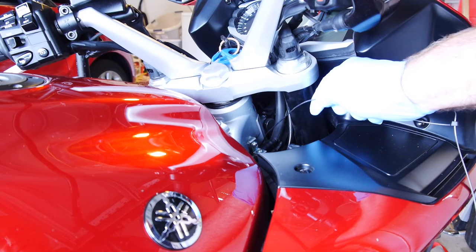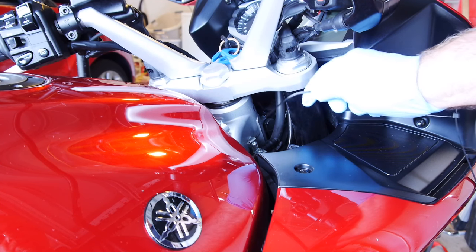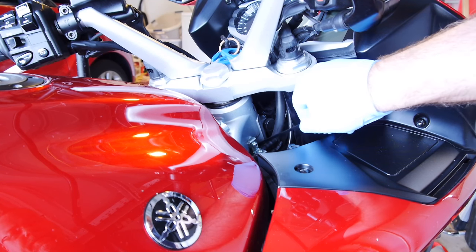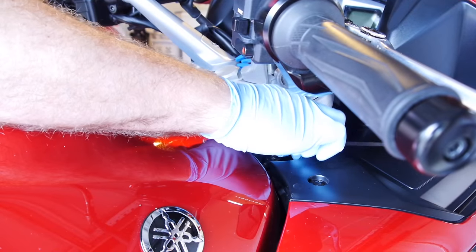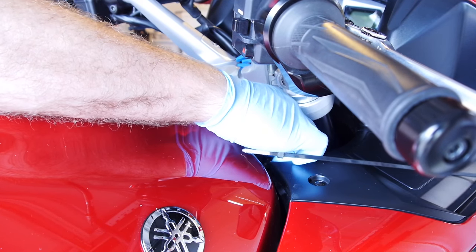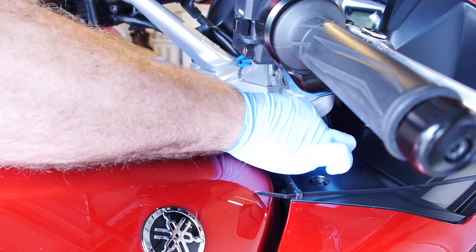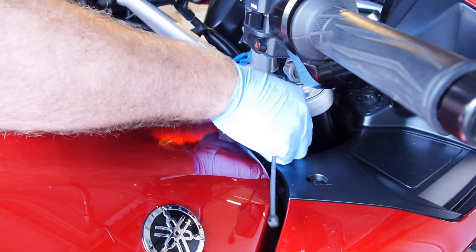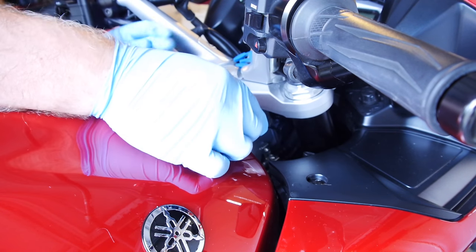It's important that you go completely above and around the brake lines and other control lines. You want this strap to only be up against the frame. Feed the zip tie through and when it comes out the other end, make sure it's not in between any of those control lines — you want it completely on top, only on the frame. Feed enough through so it's not going to fall out.